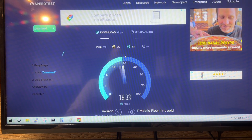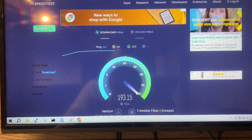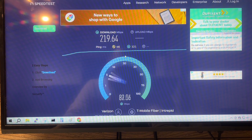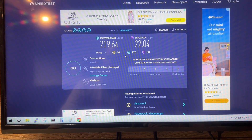The first thing I'm going to test is from my computer, which is physically connected to the LAN — let's see what a physical connection is giving us for speed, and then we'll decide how the Wi-Fi is doing from there. Looks like we're doing about 212 to 208. So that's going to be kind of our baseline — it spiked up to 224, but around 220 is what we're getting. The upload speed here is 20 megs. We're going to use this as our baseline. The next one I'm going to do is connect wirelessly from my phone to the main puck, and then start connecting to the mesh and seeing what happens to the speed.